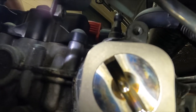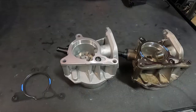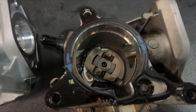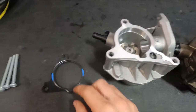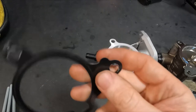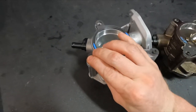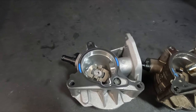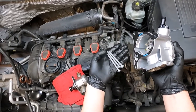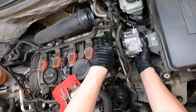Also, you see this slit in the middle of the camshaft right here — when you're putting the new vacuum pump on, you have to match that up with that little keyway right there. Next, I'll put them side by side and line up those tabs so that when I put it on, hopefully it goes on pretty easy. Take the gasket — on the black side of it, it has tabs right here that snap down inside these holes, which holds it on better when you're putting the pump on. I've got my pump, the gasket, and the three new bolts. The mating surface on the engine is cleaned up and ready.